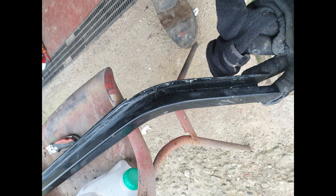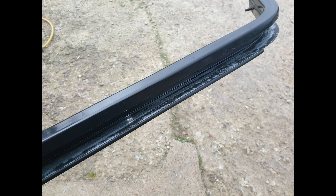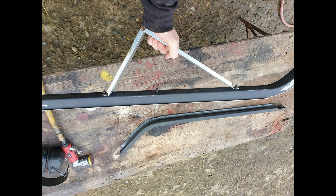This stage required a lot of work and effort. These door reels and runners are powder coated from factory, with a zinc coat below the powder. You don't want to break or remove that zinc coat. So I had to remove the powder without harming the zinc. I didn't use the old runners that came up at the start of the images because they were too badly gone — the runners had eaten through the metal itself.